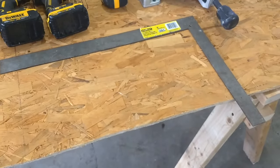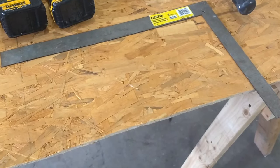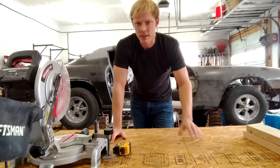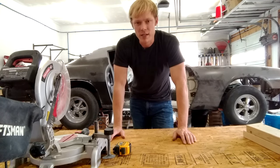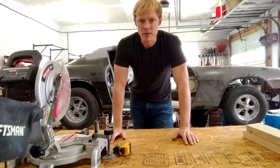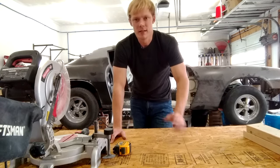You might need a square just to get the first couple of layers of the wheel crib going. For this wheel crib, we need 10 pieces that are 10 inches long and 8 pieces that are 14 inches long — this is for one wheel crib. You start and end the build with the width pieces. We're going to do all of our cutting first. I've already made four that I showed you earlier, so this is just to show you how to do it.